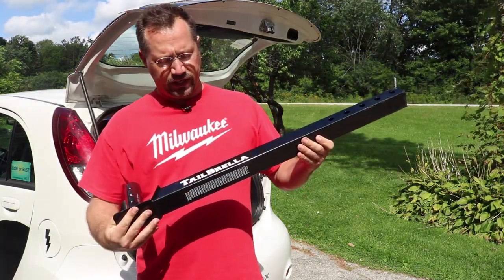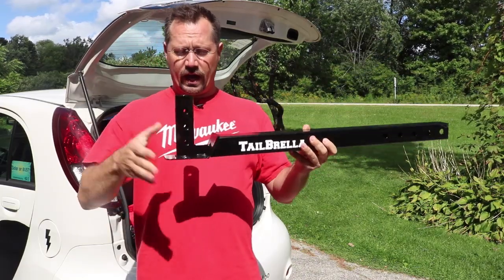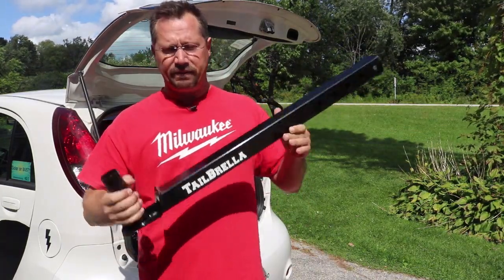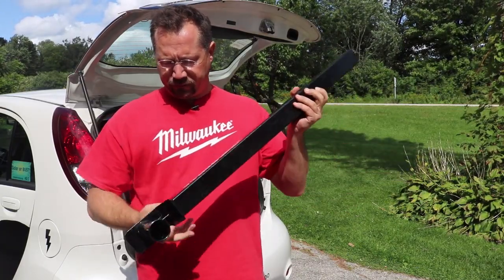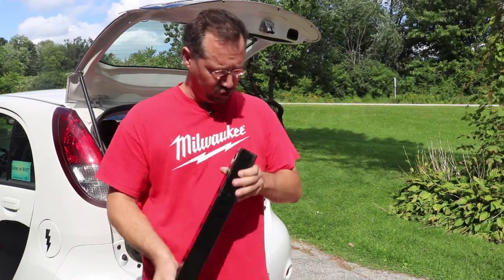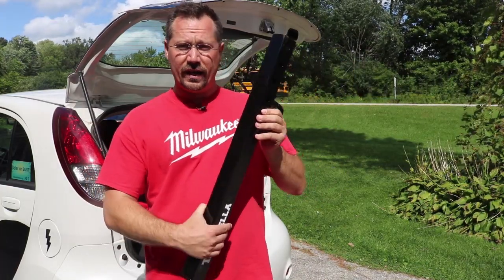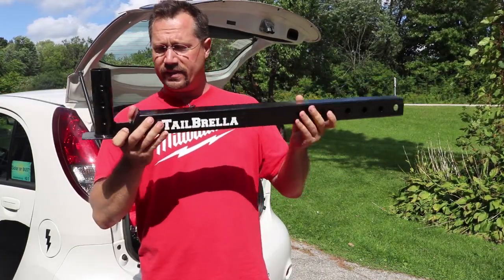The fancy main part here is the piece that actually sticks out of the car. This is 32 inches long, with a pipe connection at the end that is six inches high, and it is a two-inch steel tube. It's real heavy and really solidly built — feels hefty. The welds on it look really good, and it has a nice powder coat finish paint job. It is painted inside and out, and it has five holes on the end so that when you slide it into the receiver, you can adjust how far out it sticks.